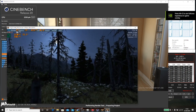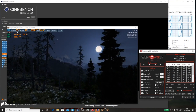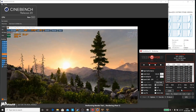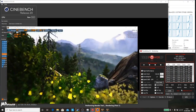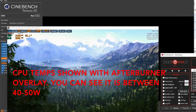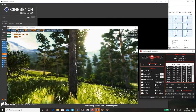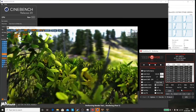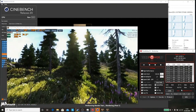I'm also going to run it again with the GPU activated at the same time. Before disabling the Lenovo thermal service, when you're running the GPU and the CPU together, the CPU would regularly throttle down to about 20 to 30 watts. By doing this modification, my CPU now does a short-term boost to 50 watts and then throttles to about 40 watts, making it a much more effective system for long-term use. I can run it all day at these temperatures and still get good CPU and GPU performance without crazy fan noise or the laptop overheating.